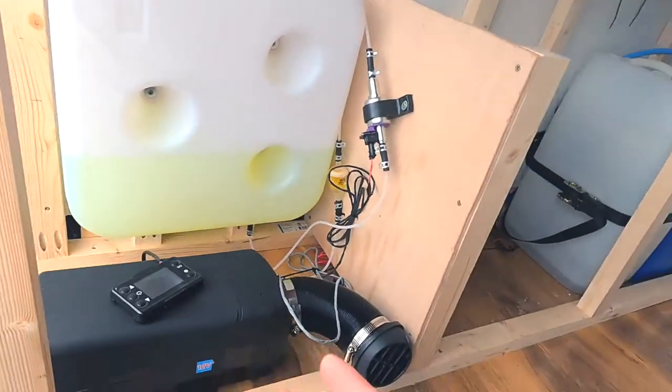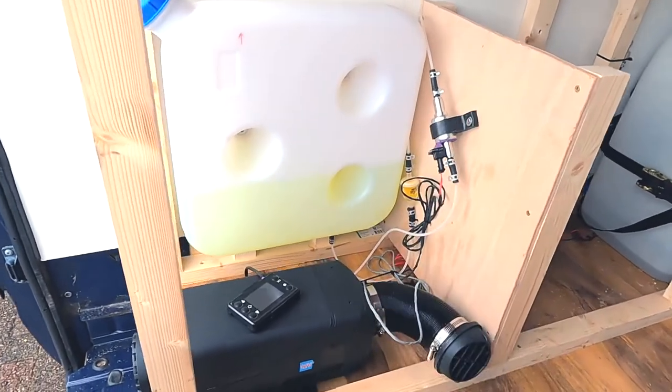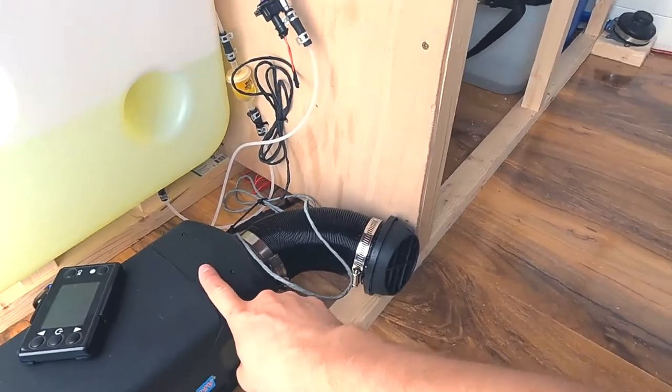It's been a few days since I put the tank in and faffed around with the heater, but I have some good news — it's all fully installed and it works. I've got it all mounted properly; this is probably the final configuration. But let me talk you through a massive issue I had. When you first turn one of these on, you have to prime the fuel lines — turn the pump on to suck fuel out of the tank into the heater. It took me maybe six goes around the priming cycle and I wasn't really sure why. When I finally got it primed and tried to turn it on, just as it started to tick over, it would cut out with a warning sign showing E01 — error one — which means there's not enough power getting to it. I thought: have I bought the wrong one? Is there something wrong with my battery?